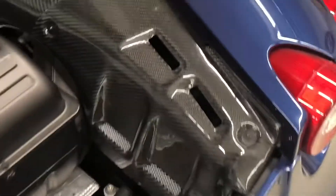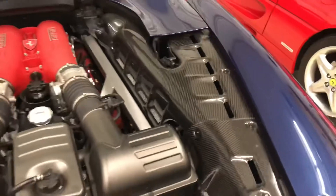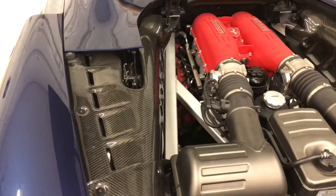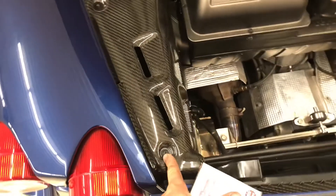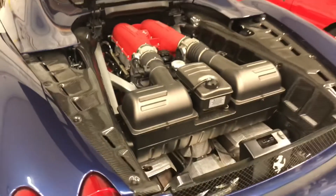This one you can pull all the way out, really not a big deal. I actually put these carbon fiber panels in about a year ago, so I've done that part before, but that's kind of imperative to get to the coils, at least the front ones. I believe the rearmost coil you can probably get at without that, but step one for me is just gonna be grabbing a four-mil Allen on a socket and zipping those bad boys right on out of there.